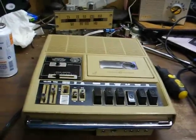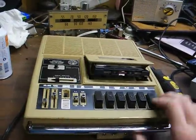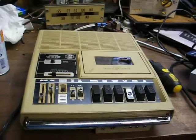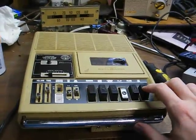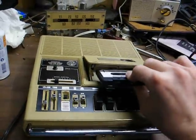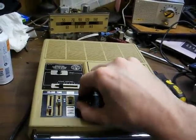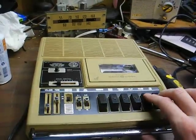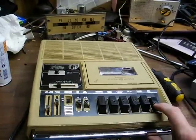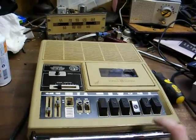Now you're back to fifteen-sixteenths inches per second. [Cassette: 'Side two, tone one, twelve.'] When side one is finished, you simply take the cassette out, turn it over, and push play — side two is ready to go. When side two is finished, you take the cassette out, turn it back over where the label side is facing up, move your track select switch to the three and four position, and press play.